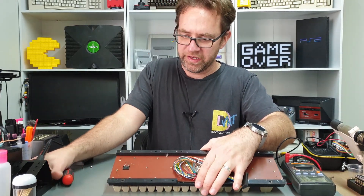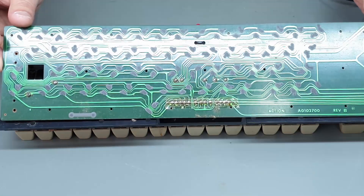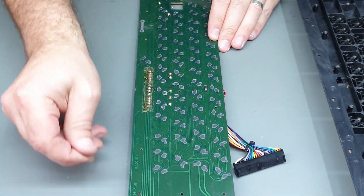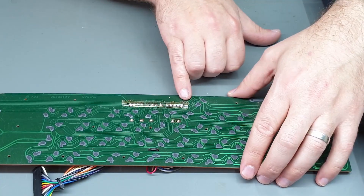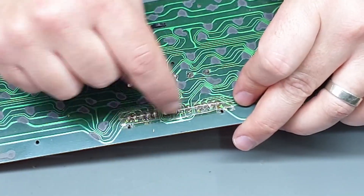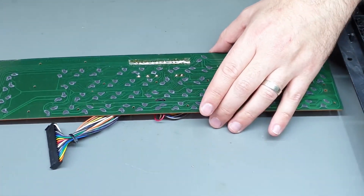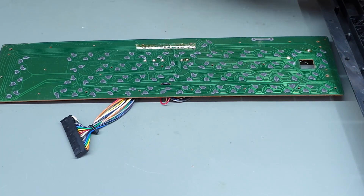Next step is to remove the PCB and have a look at the traces to figure it out from there. I'll pull out these five billion little screws and also remove the shift lock wires. Well it is dirty, but there's something more than dirt causing this problem. In tiny little letters just below each wire it does tell you which row or column you're looking at, so C is this one, just here, the third one in. Let's do another quick trace around the board and see if we can work out where it's broken.